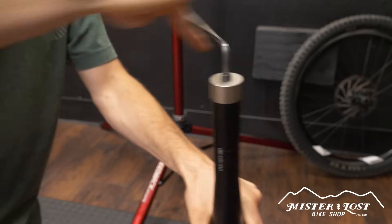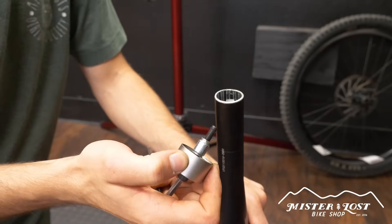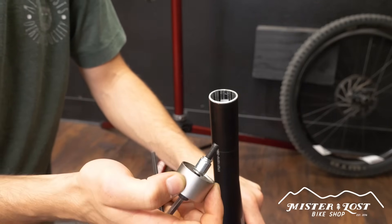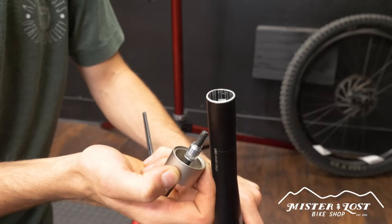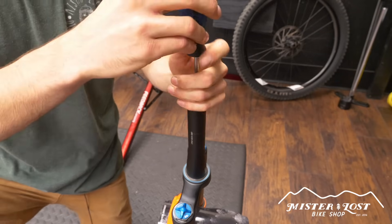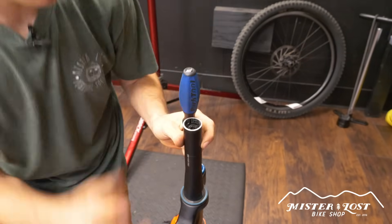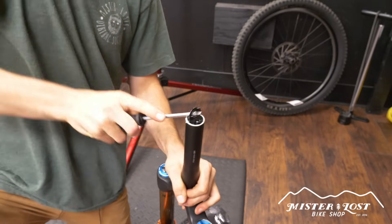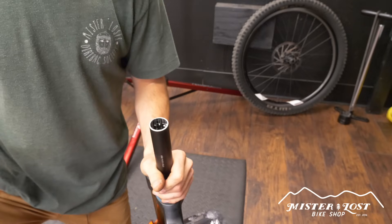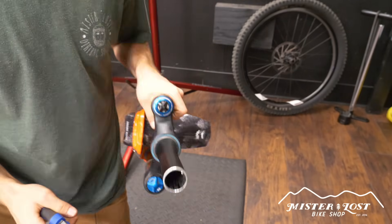This will take a little bit of elbow grease but just keep tightening and it will eventually pull your star nut out. One of two things will happen depending on which star nut is in your fork: either you'll pull the whole thing out, or you'll pull just the center part out. On mine it pulled the center part out, so I need to use a punch or flat blade to knock the rest out. It's actually pretty easy — use a flathead screwdriver and a hammer, hit it on the side, it'll turn sideways, then pull straight out. Do that for both the top and bottom of the star nut, and grab it with needle nose pliers at the bottom. Now your steer tube is hollow again.